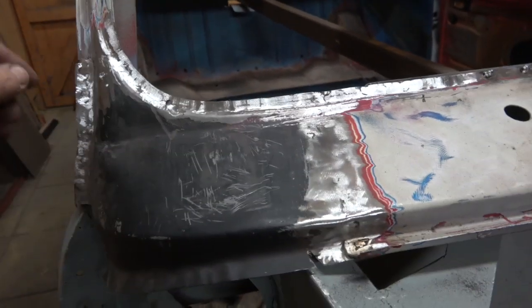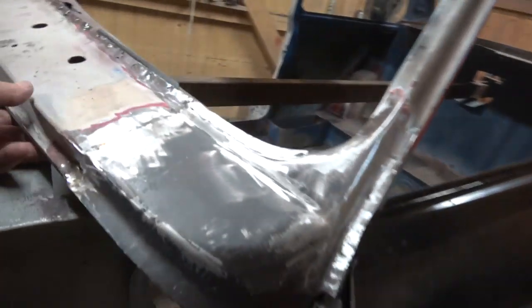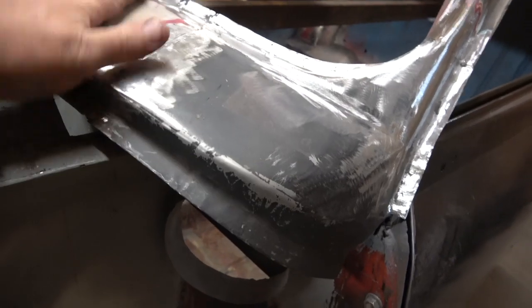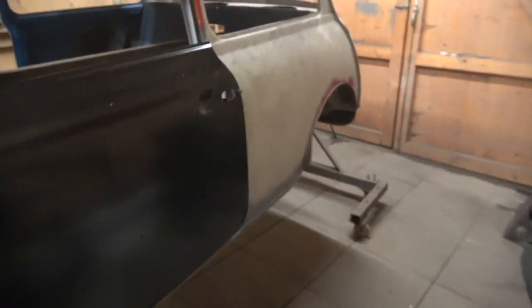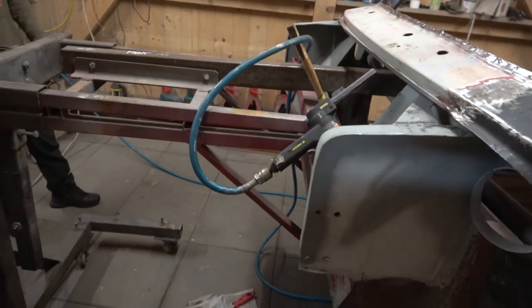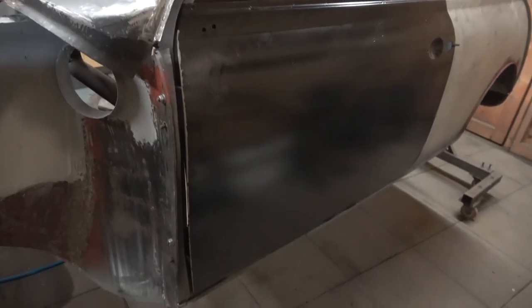The scuttle is in place — you can see it's got to be re-welded a bit, bits and pieces there. You can see where it's just been spot welded on but it's extremely strong. Normally it would sit on the wing, but we've made 3mm wings and they're further down because of the carbon fibre. It doesn't look like they need any supports in there — it seems pretty solid. There's one of the doors on — quite a nice fit on the door. What we're going to do is get the front cleaned up, put a bit of primer on it and then tomorrow we'll start on the A panels and fitting up the front. We'll take it off this jig and put this hydraulic table under it so we can set it up and see how everything sits.